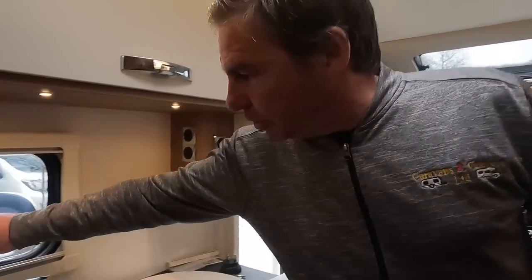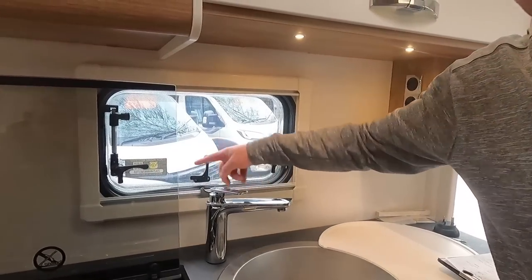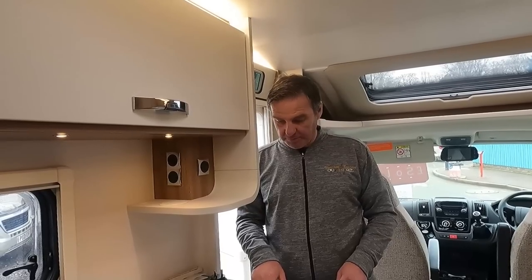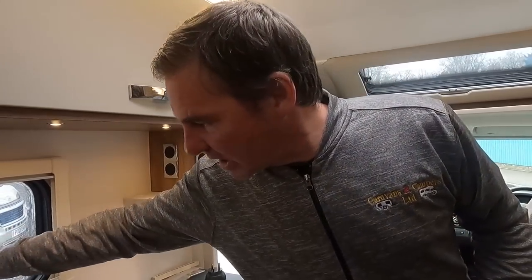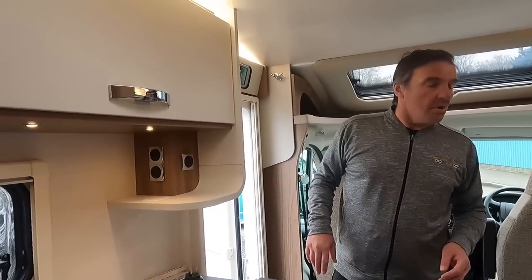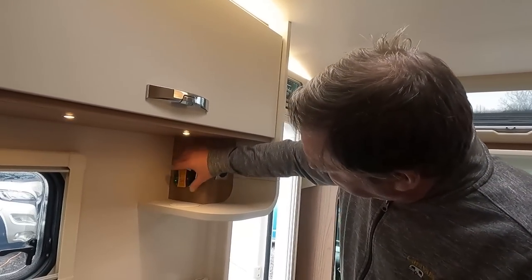The only thing we need to do is we'll just whip around, because I like to do these last. I've cleaned all the rubbers up. We'll just whip around and silicone spray them and just double check the hatches are all nice. Why do we silicone spray the rubbers, Jason? Good squirt on my list. Yeah, but why do we do it? Just revitalises them. It stops them sticking to the windows. And if you do come to open a window on a van, if you've not opened the window for a while, don't force it because you'll rip your rubber. Ease them off gently. Bit of silicone spray.